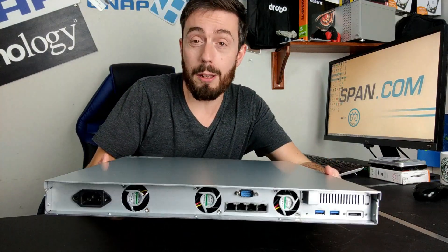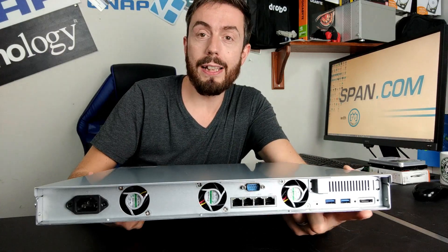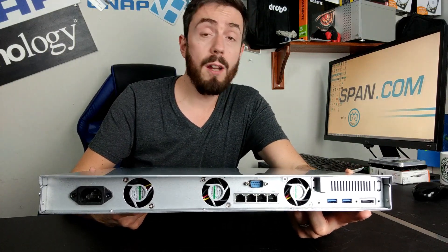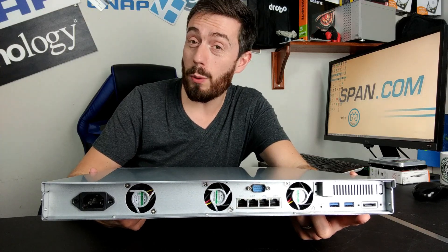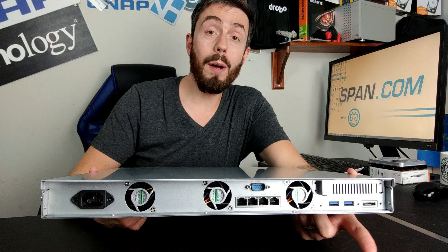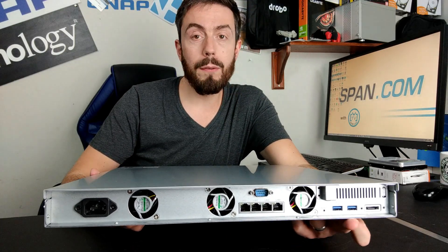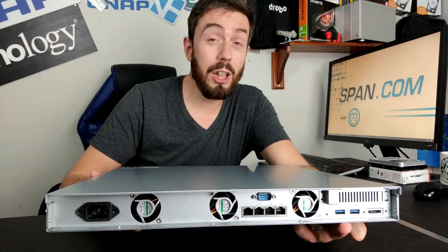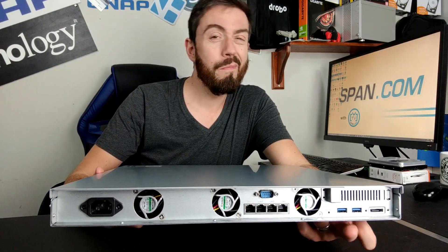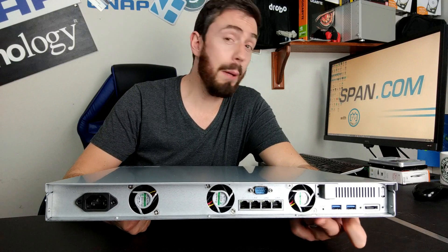When talking about hardware on this 1U 19-inch rack mount NAS, we should really take a moment to talk about the ports and connections. We have an eSATA connection which allows us to expand the RS820 from four bays to a total of eight bays with the RX418. That expansion device retails for about 400 or 500 quid and is non-RAID enabled — you have to use the CPU in this NAS to handle the RAID across both devices. We've also got USB ports here that allow you to add expandable storage, connect UPS devices, and support a few wireless dongles, though USB ports on a rack mount NAS are very rarely useful, particularly on a Synology.